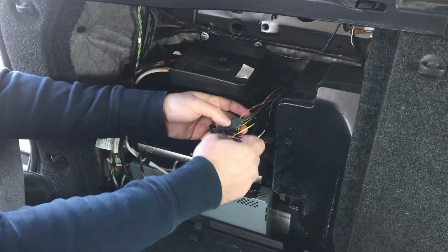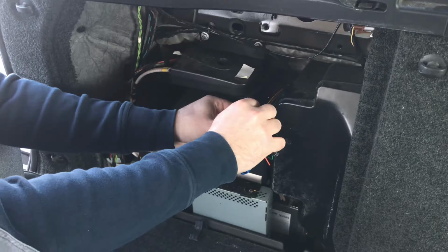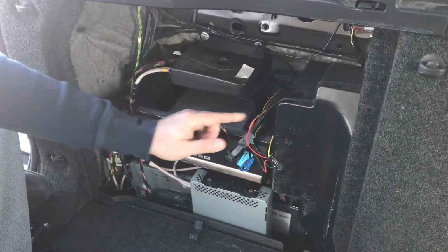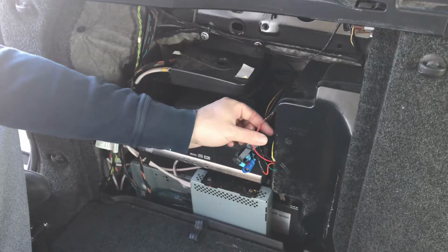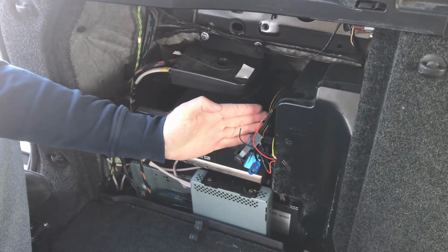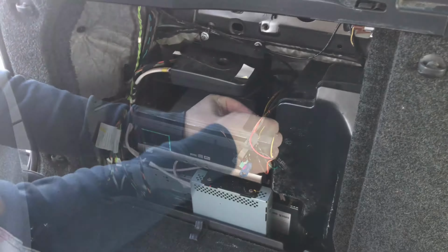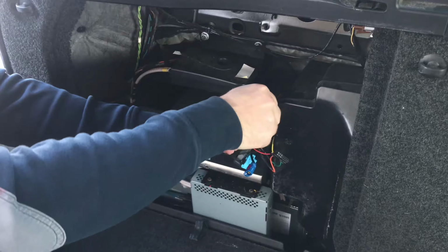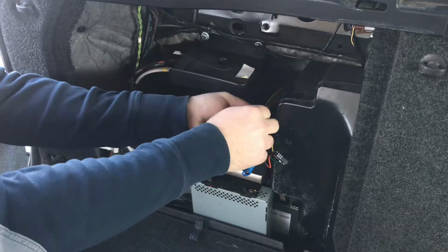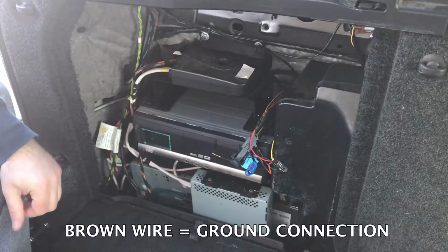and you want to insert this red wire in here and twist it around. So you insert it into the opening. When twisting this wire on, be careful. You got ground here, so be careful not to touch it. So this plastic here, but here you got metal, so make sure not to touch this when doing this particular connection. Alright, and then just apply electrical tape to isolate the connection. We prefer using good tape so it stays in all conditions, especially if you don't do taping for a living. Using more expensive tape will make your connections more reliable.